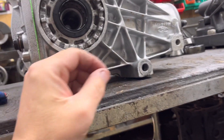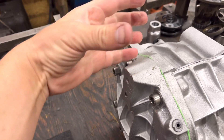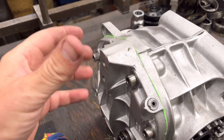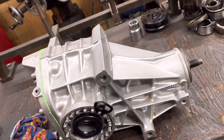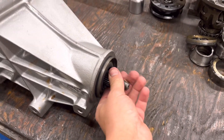What I did in a nutshell was I got my DTI on the crown wheel and we've got about 10 thou backlash, which apparently — because of heat growth and all that — is about what you're meant to have. Turning the pinion is absolutely fine.